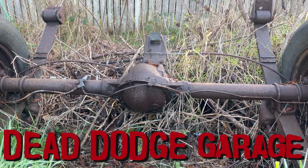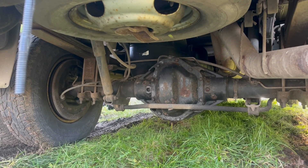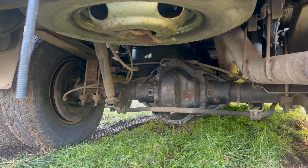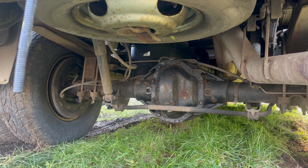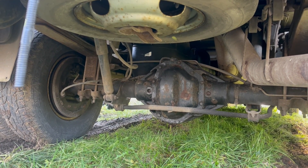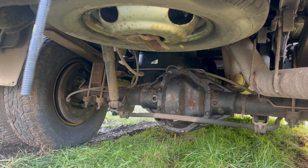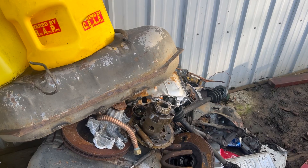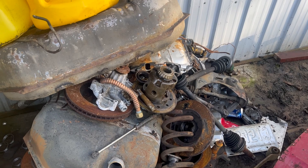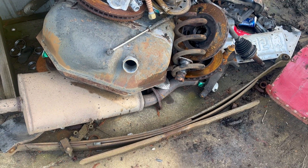In today's episode, we're rebuilding a differential — specifically, a Ford differential in an 80s Jeep. There are many different designs of differential; they're all kind of the same, but kind of not. There's a means of setting the pinion depth and a means of setting the ring gear location with either shims or screw adjusters on the side. This Ford axle has a crush sleeve on the pinion and shims on the sides of the carrier. Lots of Mopar axles are different, but a lot of the same information applies. There are useful tidbits for the average home gamer who wants to rebuild an axle and has never done it before. We'll definitely be doing an eight and three-quarter Chrysler setup at some point in the near future.